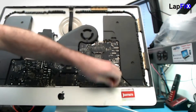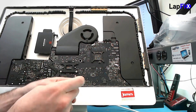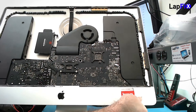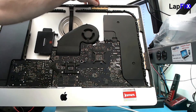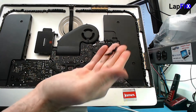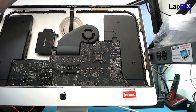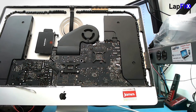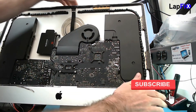You can see there's adhesive that goes all the way around here, and obviously this hasn't been done well — this needs to be removed. This is the old adhesive. Whenever you put anything that has adhesive down, you want to make sure you remove the old one first. You can see how bad this looks; it's peeling off. If you do a replacement, not just on iMacs but on anything with adhesive, you want to remove the old adhesive and put the new one on.